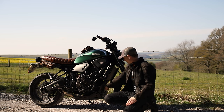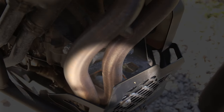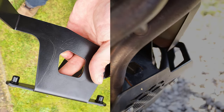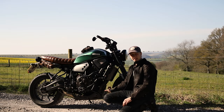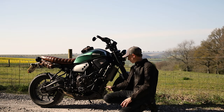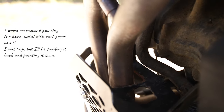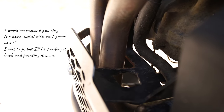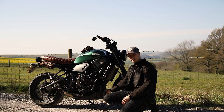It's the front bracket that actually needs a little bit of modification. As you can see, I've cut around the exhaust here on the bracket. The stock exhaust has quite a big bend in the header pipes so it clears the bracket, whereas Akrapovic and probably some other exhausts have a slightly shallower bend which means they clash with the bracket. But it's not the end of the world — you can cut the bracket like I have and it fits fine.